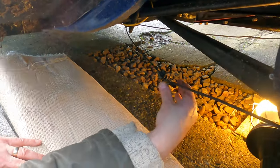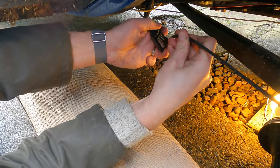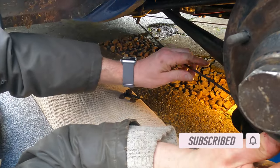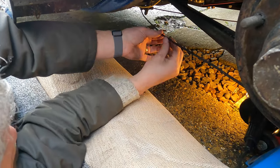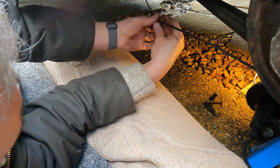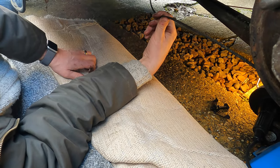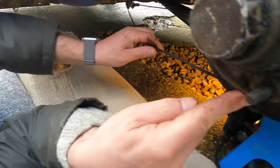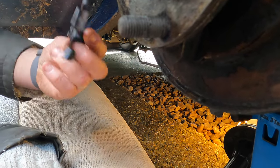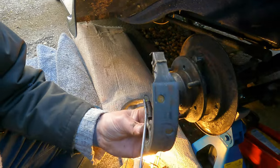Because the brakes have been adjusted, I've loosened off the adjuster at the back, which gives more flex and allows the brakes to go fully off. The cable has no doubt been stretched but it's not frayed and doesn't feel too bad — we'll probably replace the cables at some point but not today. That's given us enough to get the cam to the fully-off position, so we should be able to put the new pads on.